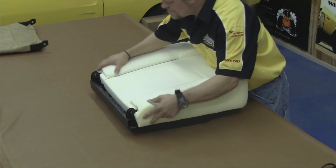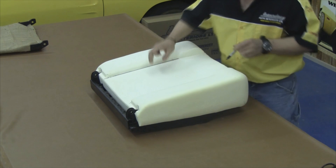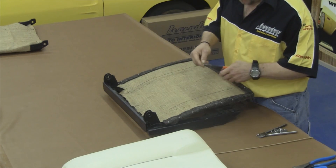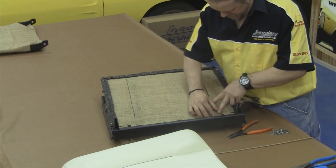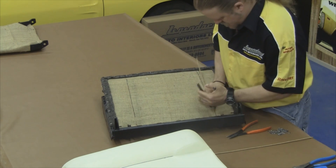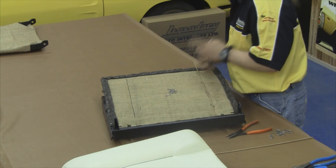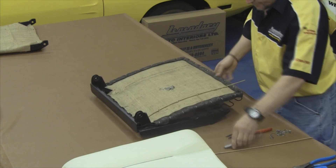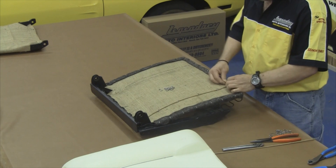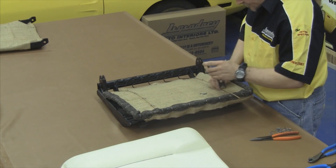Our next step will be to take our freshly cut universal molded foam kit, set it on top of our seat frame, and draw down through where we've made our cuts all the way through our molded foam. This is the area where we'll need to attach our paper-coated listing wire, so when we attach our seat cover down through our molded foam we have something to hog-ring it to. On the paper-coated listing wire, we take a 90-degree bend on the very end of it and attach it right where we drew our line with our black Sharpie. When we get to the front edge, we put a 90-degree bend on it and tuck it up underneath the 2-inch felt so the paper-coated listing wire does not travel front to back and will not prematurely wear through your seat cover. Repeat the process on the opposite side.